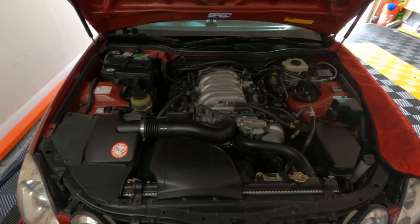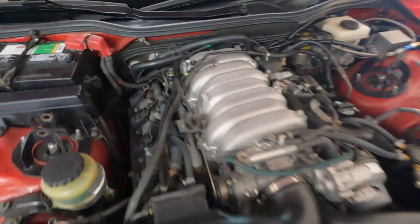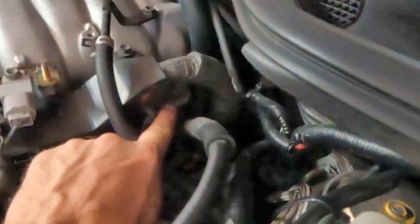What's going on guys? Christian here with Ford Momentum. What you cannot smell is the fuel smell that I'm smelling. It is caused by something called a fuel injection pulsation damper. This is a new one that I've already put on here on the bank two side. I have one that's leaking and I can smell it in my garage.